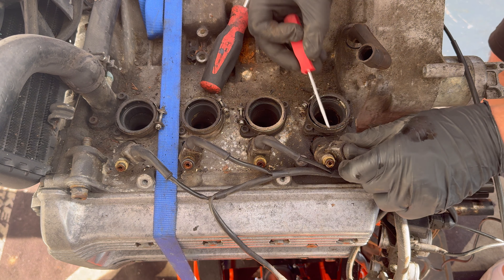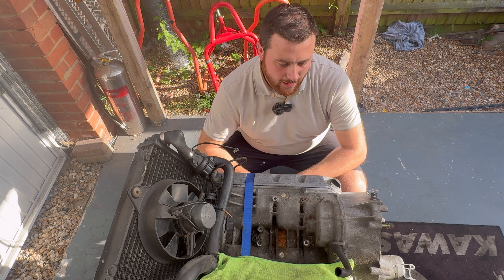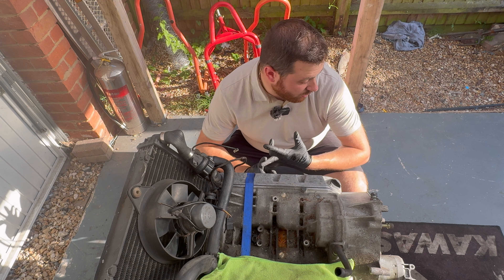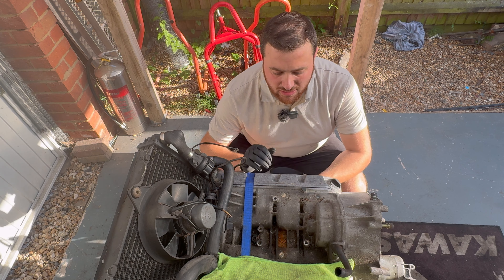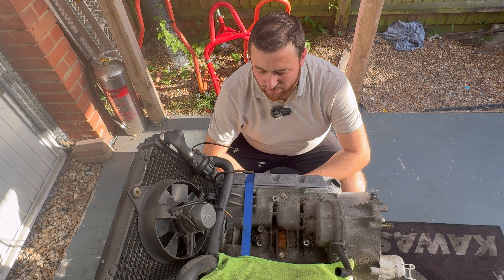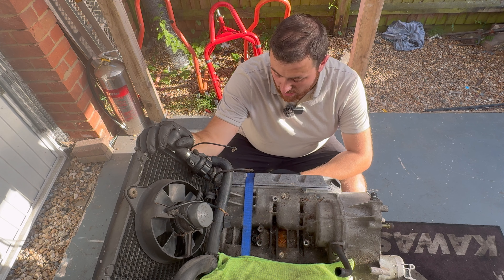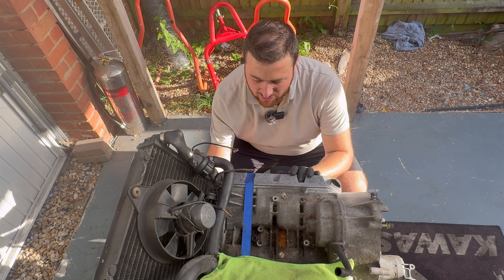That's all the wiring off, and then it pulls away. So as you've just seen, we have removed the intake system: we've got an air box, some throttle bodies, and injector plugs. The only thing I've not removed so far is the injectors - I want to keep them in because I'm going to clean all this out. The next video will probably be removing the cooling system and checking what it looks like inside the radiator. I need to do some research - I need a Haynes manual to tell me how to check this water pump.